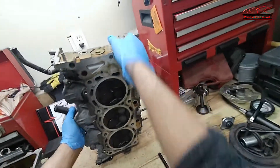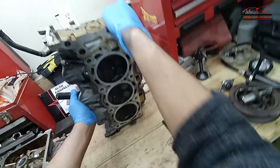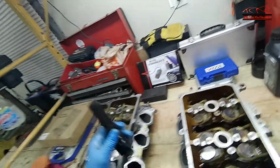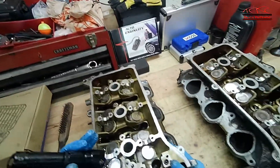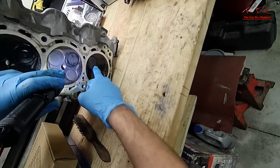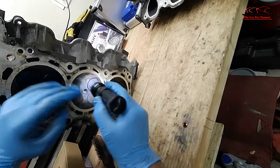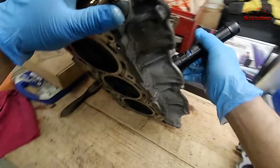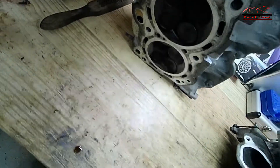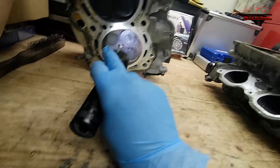This is the same on the other valve too — so I have two intake valves that I know are bad on the left side. For the right side it's the same situation on two valves. See this valve right here and this valve right there — those are intake valves. If I shine the light here, I can't see the light but still it does not look good. Neither one looks good.